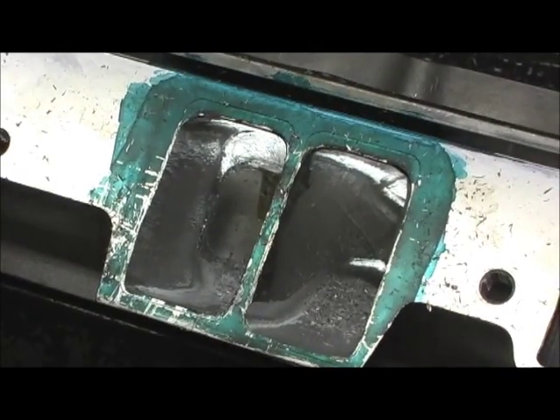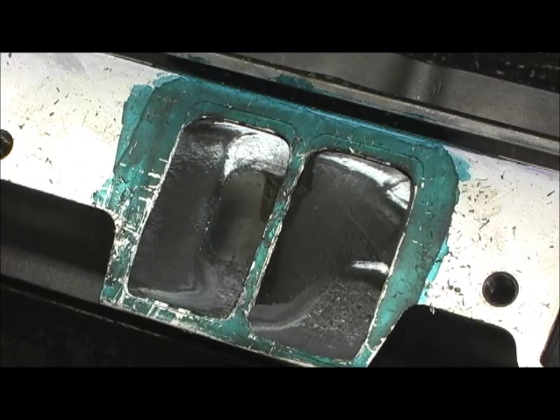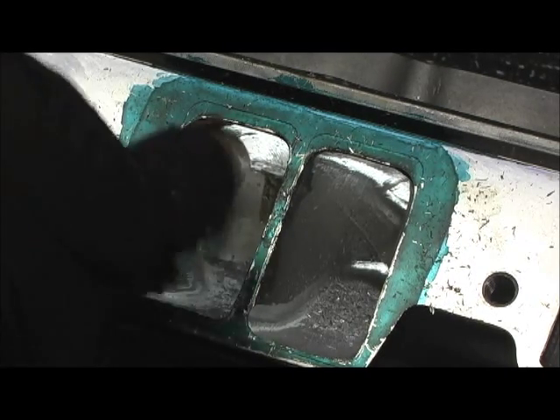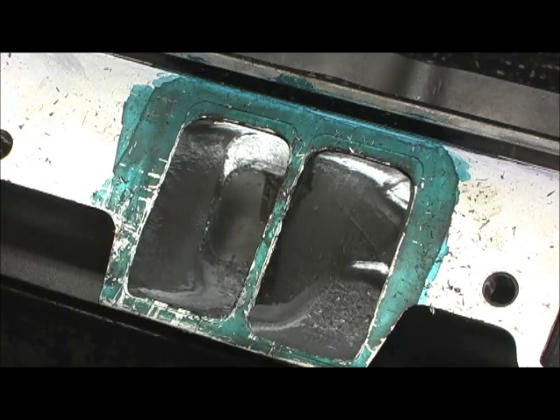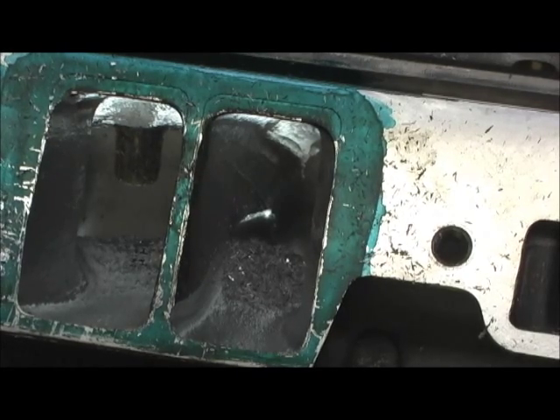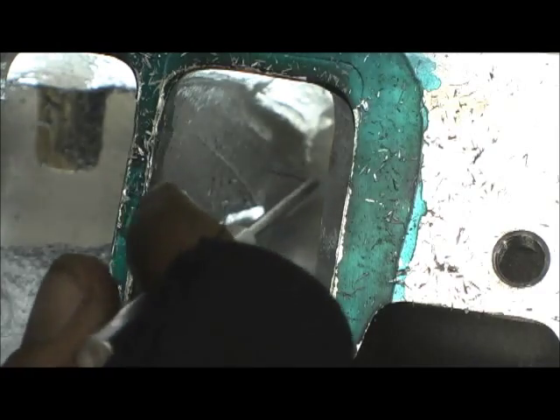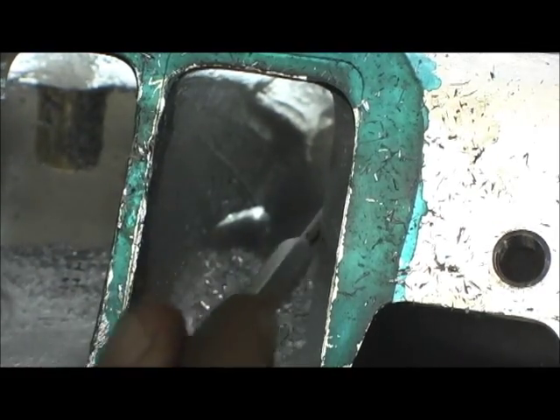I'm going to continue on and the next part you'll see me do is go ahead and clear the side part off — the push rod side where I dug the trenches going on down the port. Now that I've opened that up as far as it can go and blended it to a point, I've got a piece to pick off of. Now we're going to go in there and take out our clover leaf. When I say clover leaf, that's the trench here and the trench here on the top, and we also had a trench on the top where I raised the roof.